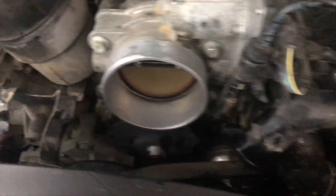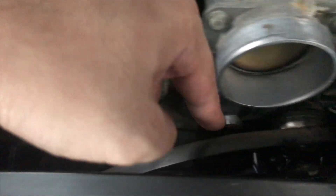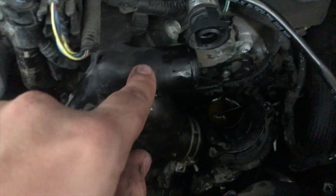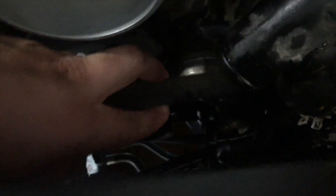Here's what I've disassembled so far. I've taken the upper radiator hose off from right here — it routes through this little sling into what's called the crossover pipe, and we're going to replace this. I've also removed the hose going from the crossover pipe into the thermostat, and we have a big mess underneath the car but we're going to clean that up. I've also undone the tensioner and the serpentine belt.